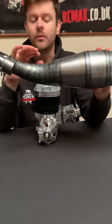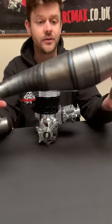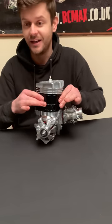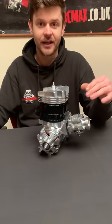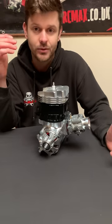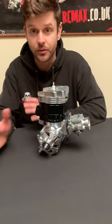We significantly modified their design for the header section to suit RC and a single gear - we needed more torque and wider power range. This pipe is actually bigger than the biggest pipe you'll find on up to a 100cc super motard bike. It was a case of: get the pipe design done, then make it fit the car. Not 'how big a pipe can we fit?' It was a challenge to fit, but for the first time in big bore RC above 71cc, we've got a pipe of the size we should have, instead of the size that can fit.